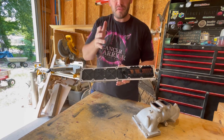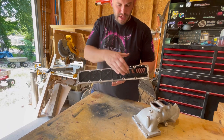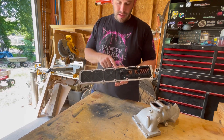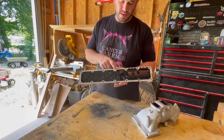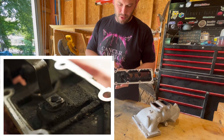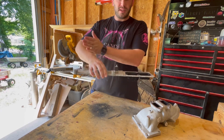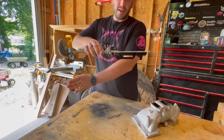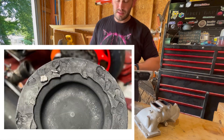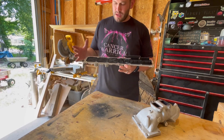What's been happening is a lot of people around 100,000 miles have been seeing catastrophic failures. With the heat and the soot coming in from the EGR, this nut - sorry, the stud - is failing. After it fails to a certain point, it falls off. The cylinders go from one through six, the stud falls off, goes into the intake and back to cylinder six, which in some situations cracks the pistons and causes a catastrophic failure that can cost several thousand dollars to repair.